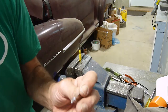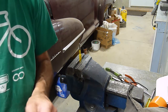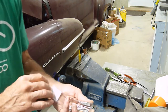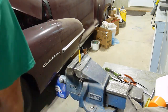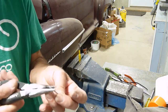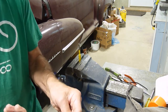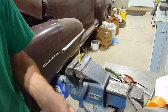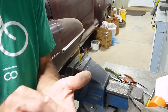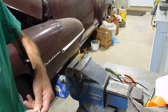So these are stainless steel. Well, that one's not stuck in there. Oh, these are aluminum. I'll get the stainless steel ones. These are stainless steel rivets. So in absence of the ones without the rod, all I have to do is, I want the pop rivet shoulder, do that, pin drops out, then you have the rivet shell. That goes into here. There we go, it's in.